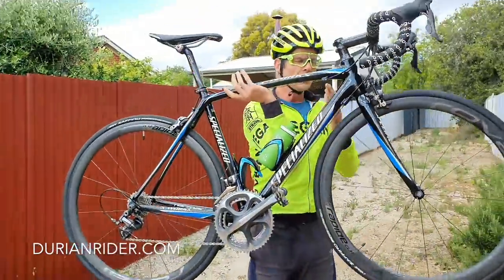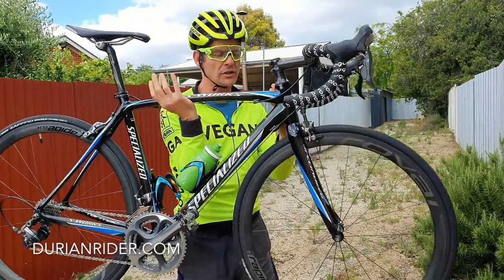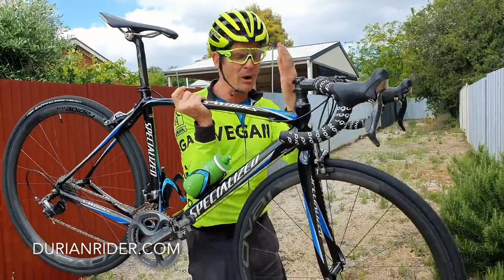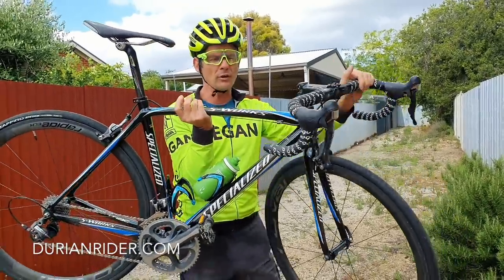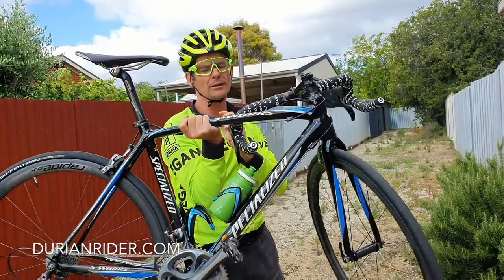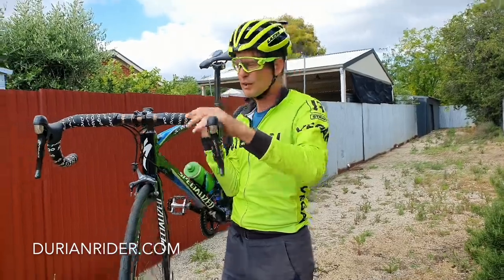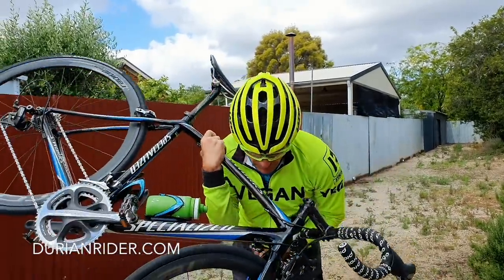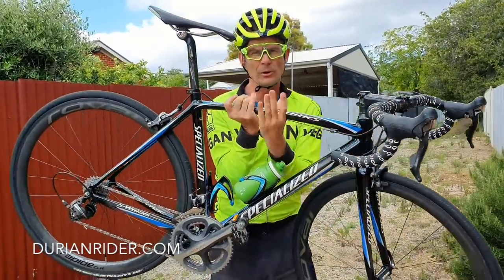Four would be hitting something front-on like a gutter and causing a crack in the fork — that would be quite evident and eventually the whole front end of the bike could fall off. But you'll see that really clearly; a bicycle doesn't just fail — you'll see a big crack and it'll be very evident. Another one is the handlebars coming around in a crash and causing an impact fracture. The bike's not going to fail in half, so get it fixed or not. This one doesn't have any dents, but a brake thing in a crash in a crit can turn around and pop a hole in there — still rideable in my opinion.